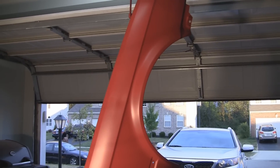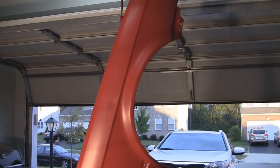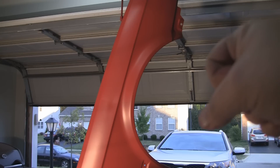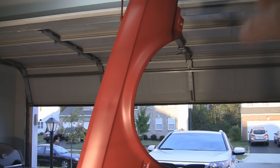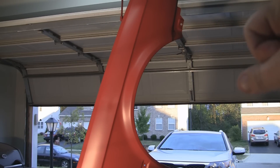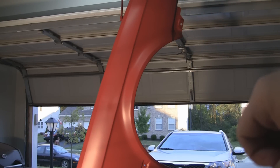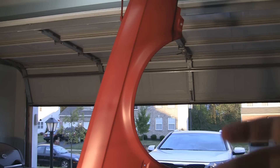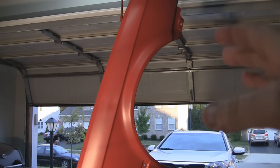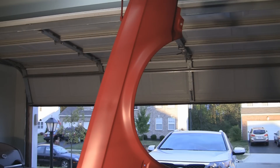The clear is exactly the same. You've got to wait about 15 minutes before the base coat dries, then seven to eight inches away from the panel, consistent. You want to overlap a little bit and about five minutes in between coats — they recommend two to three coats. I've read that five coats is a magnificent combo, so we're going to put five coats of clear on this and see what it looks like. Stay tuned.